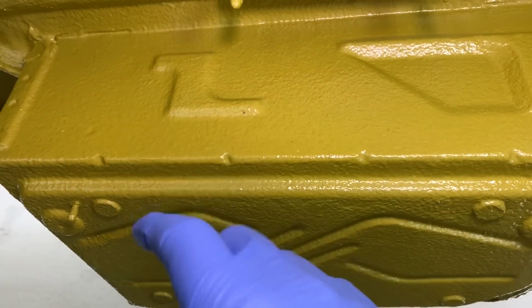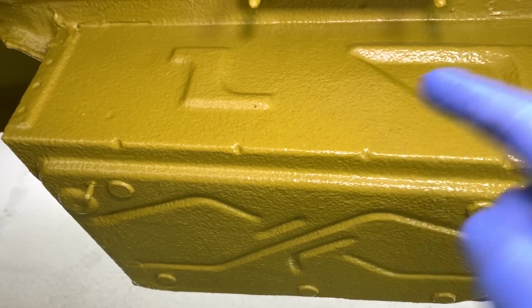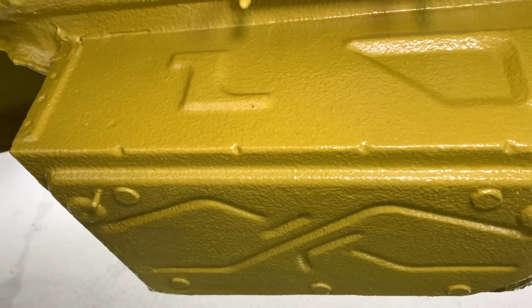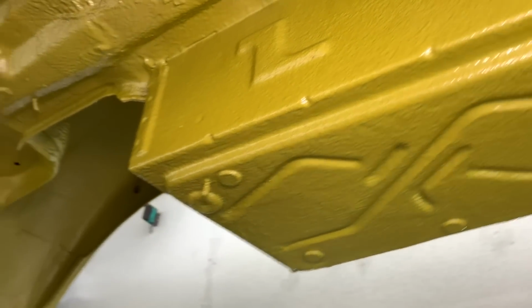Battery box system is all dealt with. Brackets up here have been removed. There were two brackets at the top and one long one here, suffering with corrosion. That's blended out really nicely, so you don't even know that anything was there. If you hadn't really looked at an E46 before, you would just assume that that seam sealer under there is the exact same seam sealer applied from factory here, and it's just because we do a nice blend-in job.